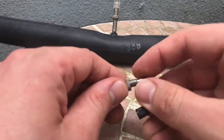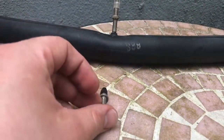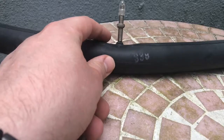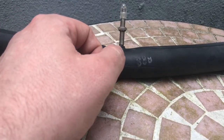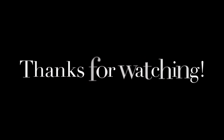It is tightened again after the tire is inflated and the pump removed. The valve cap protects the valve body, keeps dirt and mud out of the mechanisms, and also prevents the valve from damaging the tube when it's rolled for storage — but it's not necessary to prevent pressure loss. Thanks for watching — please subscribe and give me positive feedback, see you next time!